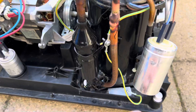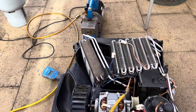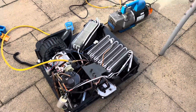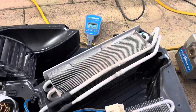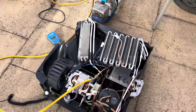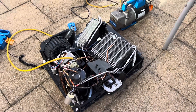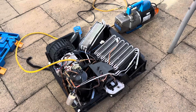You don't have to know all these things or how they work — you only have to understand one thing: it's not very hard to repair this, if you have a friend or family member who is a specialist in refrigeration and you know how to braze aluminium. I was a little bit worried about aluminium, but I bought an aluminium brazing rod — it's a cold braze, about 300 degrees Celsius.